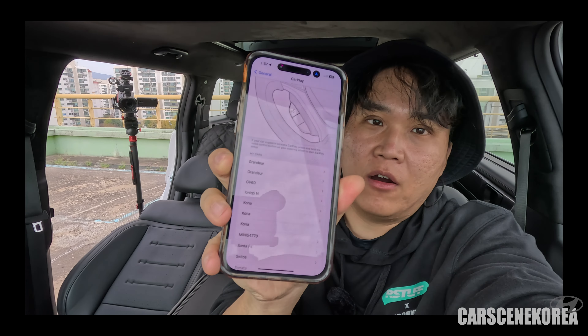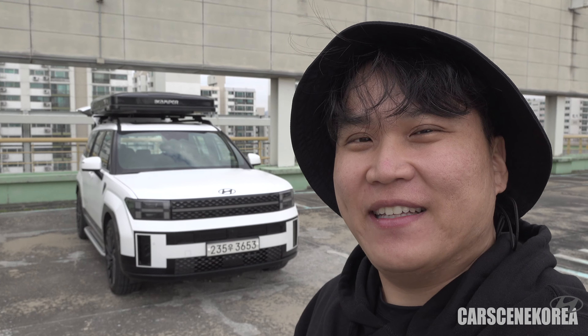I actually spent an hour to get it set up and running because I had other people setting it up and it just wouldn't work on my phone. But I figured out the reason why. And I know I hate it when YouTubers hide all the essential information at the end of the video, so I'll give you the conclusion right now: delete your setup on your iPhone and the car. If your phone has been connected with a wireless connection before, the car will somehow retain that information from the iPhone. So you actually need to go into your iPhone settings, go under the CarPlay tab, and delete the Santa Fe from there. Then you'll see the prompts and it's all really self-explanatory from that point on. Just have the wireless setting connected, the car will ask if you want the wireless connection, and boom — you finally get that wireless connection.